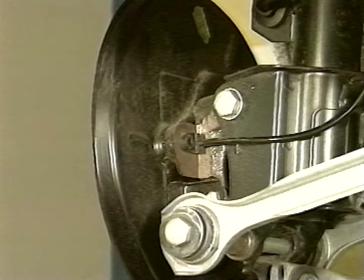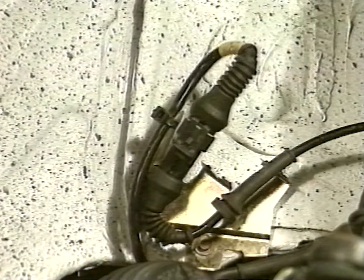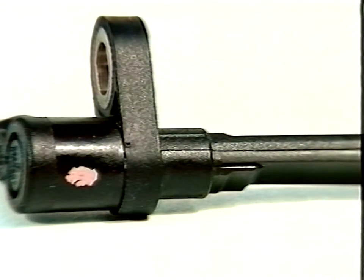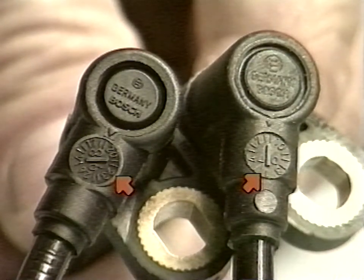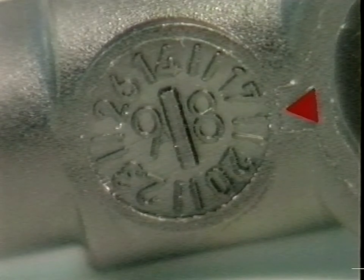The operation requires replacing the ABS sensors. Lift the car and check whether the 4 ABS sensors are updated. Updating is indicated by the orange spot on the sensor and the date impressed. Updated sensors must carry the year 98 and the week number indicated by the notch must be over 5. Modification started from the fifth week of 1998.